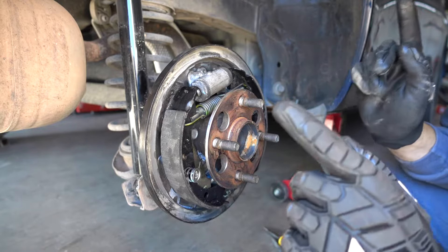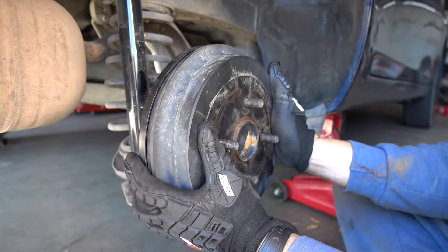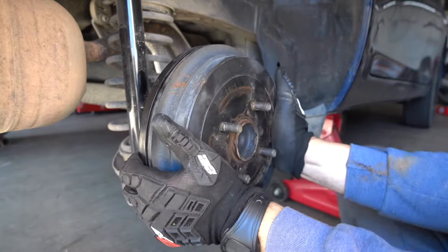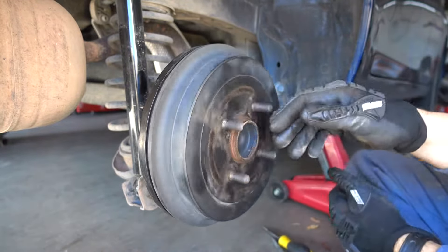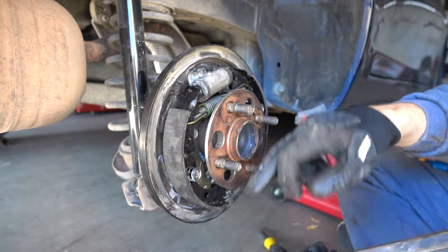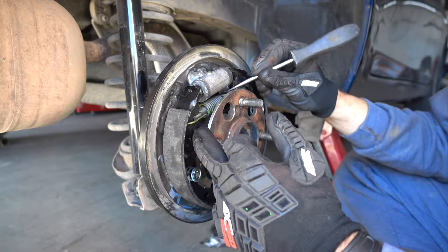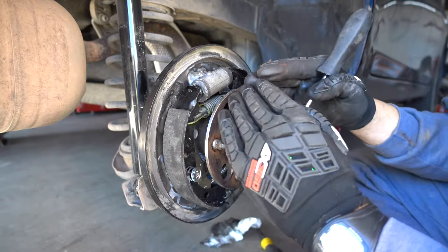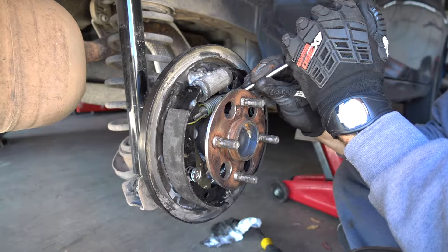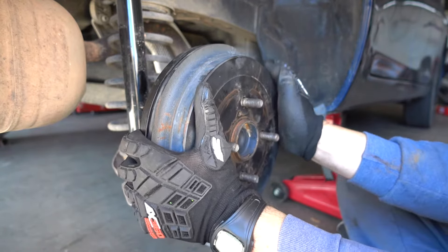But we're not done — this is a very, very important step. Clean this if you haven't already. So now when you put this one in, sometimes it doesn't go all the way in because maybe your brake was adjusted differently before. You can hear it scraping a little bit — so right now it's not scraping on that piece. Very, very important: this is why they don't use this kind of brake system on cars anymore — these are old and outdated. Remember the tooth wheel and the little lever here in the back — this lever adjusts how far the brake pads are from each other. So I'm going to put them to the maximum they could go — three clicks — then put this one back in and see how good it fits.